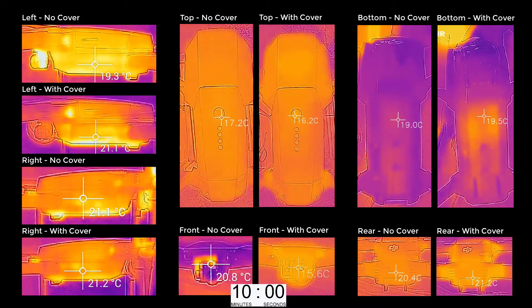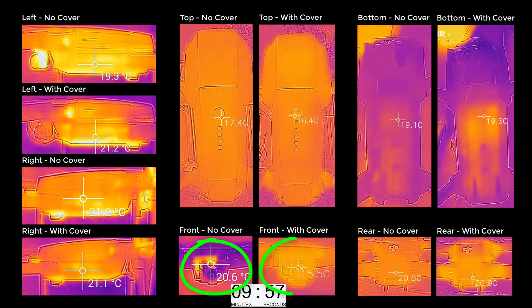We're going to run the test here to see where the heat's coming through. The way I did it was to run it for 10 minutes, with the Mavic mounted in a static state with a fan in front of it to simulate some airflow as though it was flying. With it being mounted, the fan and airflow through it would be consistent throughout each test. Afterwards, the Mavic was cooled back down to room temperature, which was about 16 degrees.